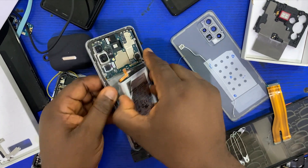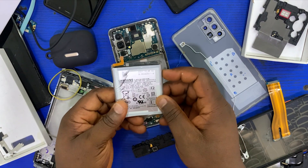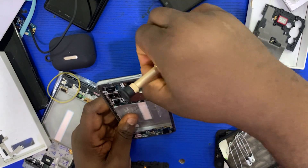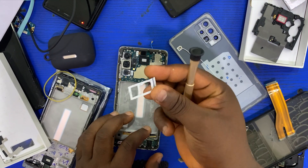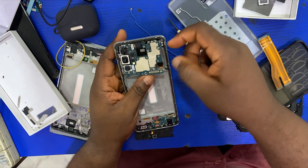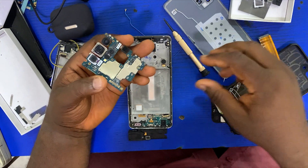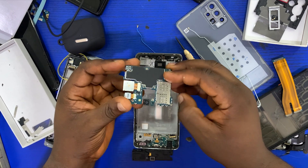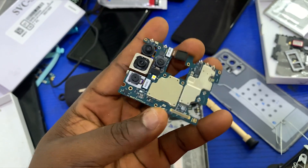The battery is still okay — it only flexed a little bit and I've been able to straighten it back. It doesn't have any punctures, so the battery is still fine. The SIM tray is still in one piece, not broken, so it's still usable. One reason why this phone might still work again is because the main board is totally untouched. I have checked it — it did not burn, it did not flex anywhere, and all the components are still sitting in one place. But that is still not a guarantee that it will work, so let's keep going.